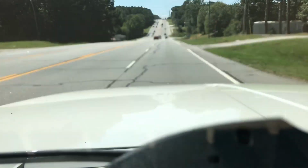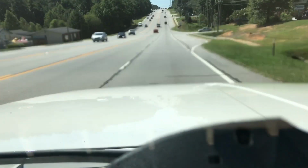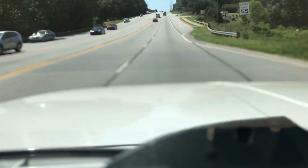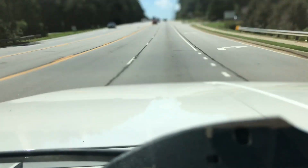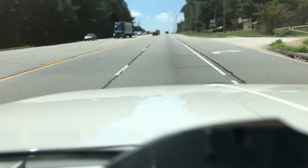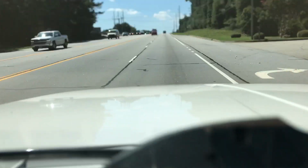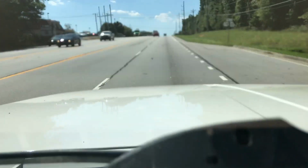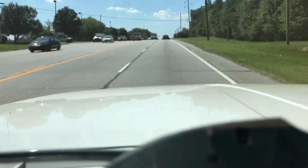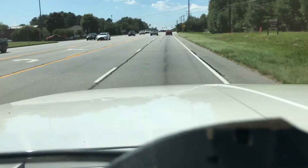But consider the condition of the tires, you know, what shape they're in, like that cupping issue I have going on. I mean, there's going to be a little bit of vibration, but that test you guys saw, I did a little bit of an experiment. I decided to rotate one tire with the BBs only, and without the BBs and the weights. Then I did another one with the BBs and the weights, and they all showed up about the same.